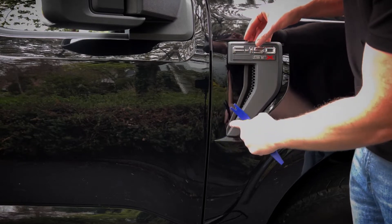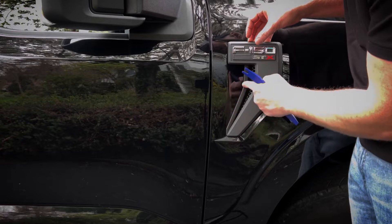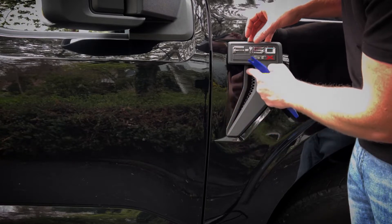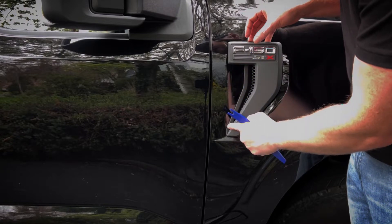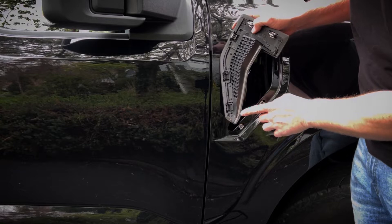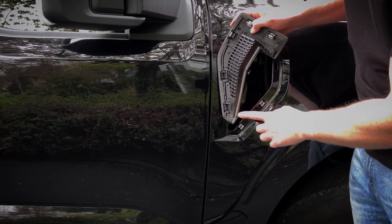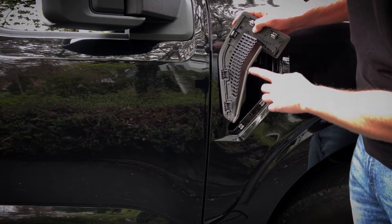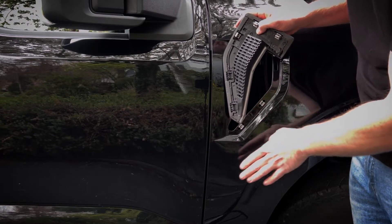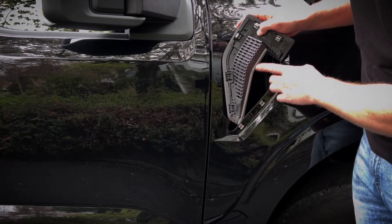It's off now. There's a little piece of double-sided tape — I like to take it off really slow so it keeps as much of the tape on there as possible. Ideally you'd want to do this on a hot day so everything stays where it is, or you could use a heat gun. I'm wary of using heat guns on paint, especially black paint.